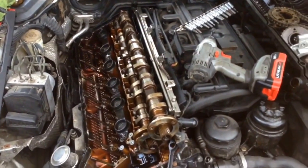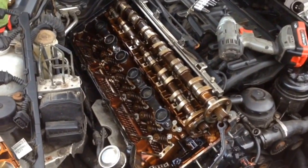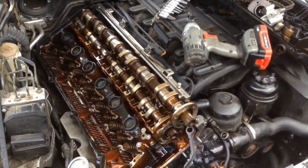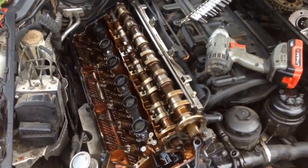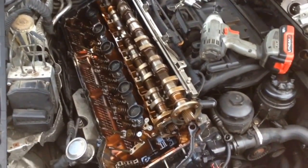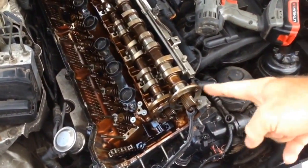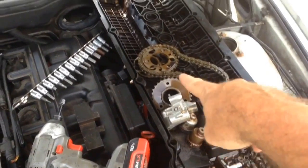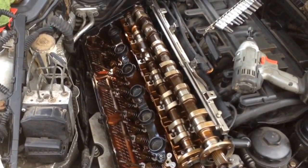If not, I don't think that Kevin, the guy that owns this car, which is a different Kevin, is prepared to spend $9 to $10 per lifter to put this thing back together. And we still don't know if that was all the noise. We're 99% sure, but it's probably either 2 things that happened to stick all the lifters. Actually, 3 things. The CCV is chucking out solid moisture, solid water, and that made the valve cover get all gooey on the inside. You can barely see it now. It's settled out. That could have stuck the lifters.